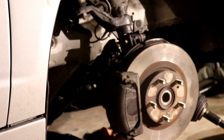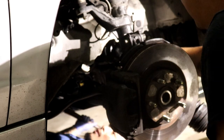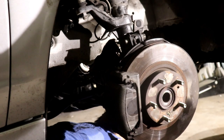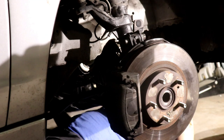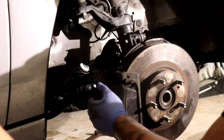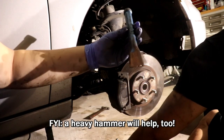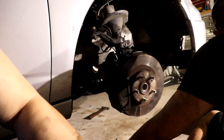It's out! We did it. It just took a bigger punch — a punch with more mass. It was so corroded. We tried all these different socket extensions because we didn't have any punches, so we improvised with socket extensions and finally got it out. I was able to get a good purchase on it, seated against the back of the axle and hit it out.